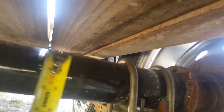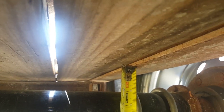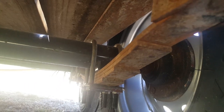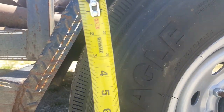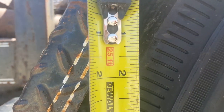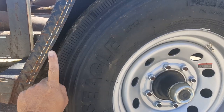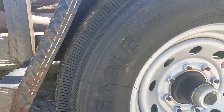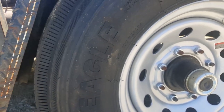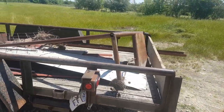As it needs to load on this trailer, I want to make sure the wheels don't hit the fender. This u-bolt has one-and-three-quarter space until it hits this frame member here. I'm going to check to see how much the tire can go up before it hits this fender well and see if this is an issue or not. It's kind of close — there's only three-quarter space between the tire and the fender — but the tire would actually have to go up almost two inches. It's limited by that u-bolt, so it looks like we're good. I'm going to take this load of scrap to the yard and see how the trailer runs.